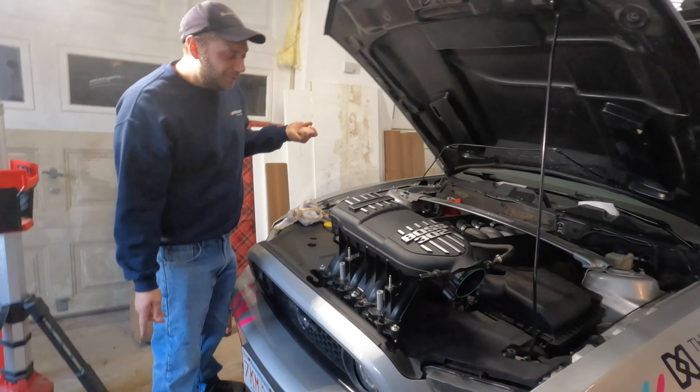See what I mean about working in cold climates with plastic? For beginners who've never worked on these, the air intake is held in with one bolt and pushed into the rubber grommets. Getting the hose up kind of sucked a little bit — the biggest problem is you don't just want to pry on it because it's all plastic. We hit it with a heat gun though, and that pulled it off pretty nicely. Just make sure you don't overdo it.